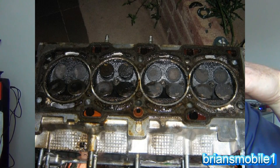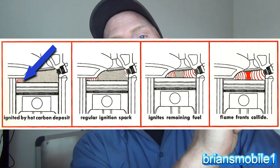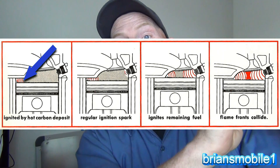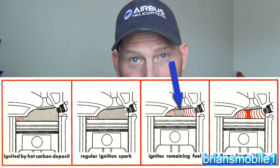So how does a gas engine start to run like a diesel? If you run a low-octane fuel, it doesn't burn cleanly — it leaves carbon and black crap all in the top of your cylinder. That carbon can glow just like coals in a campfire and pre-detonate your air-fuel mixture before the piston gets to the top. Then the spark plug fires too, and you've got convergent flame fronts trying to burn a hole in the top of your piston.